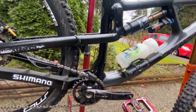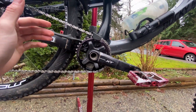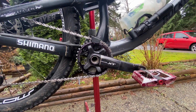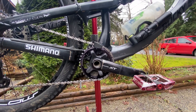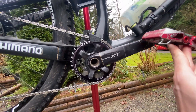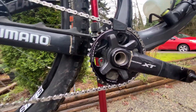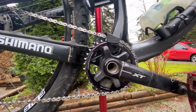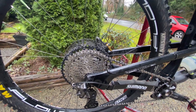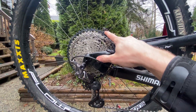With the 11-speed cranks, when 12-speed Shimano was new, I was worried I'd have to put an 11-speed drivetrain in. I called up Lou at Obsession and asked if there were any 12-speed chainrings that would fit 11-speed cranks - turns out there were. This is a Wolf Tooth chainring with 12-speed spacing but fits on an 11-speed crank. This one's a 34-tooth; I have a 32-tooth as well. So I'm running 34 in the front and a 10-to-51 cassette in the back. SLX cassette.